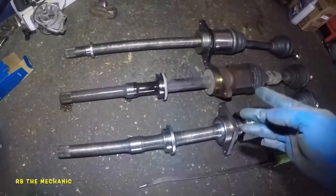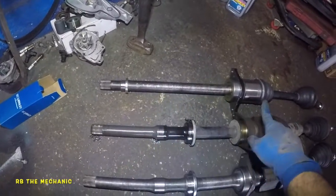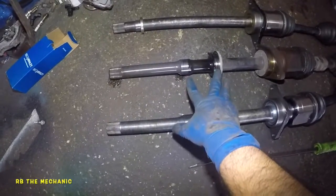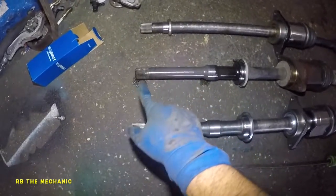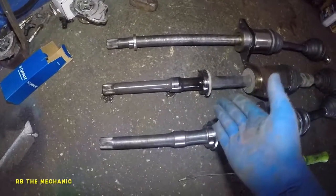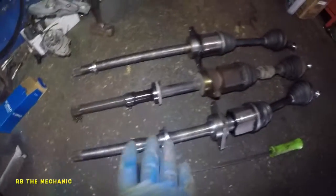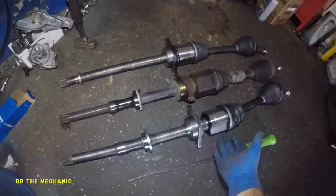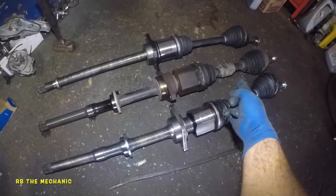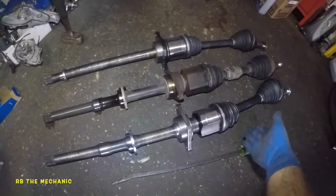and so that one is for 2-wheel drive and this is for 4-wheel drive. So this goes through the differential, the gearbox in the front, and then it goes straight into the transmission, or the other way around, whatever the scenario is. But anyways, always check your axle before you put them in the vehicle. So I talked about that little guy. That's important too, but aftermarkets don't have that. So this here now we got the correct axle.